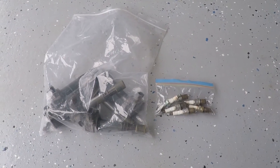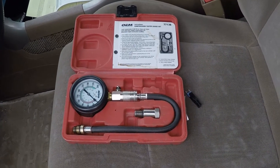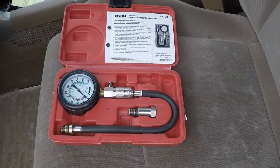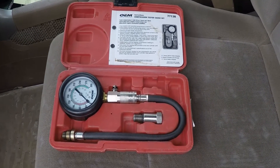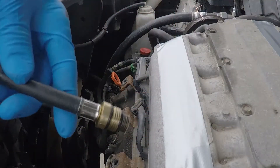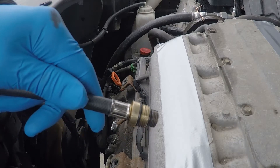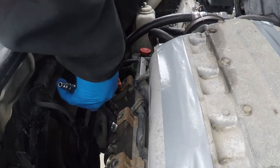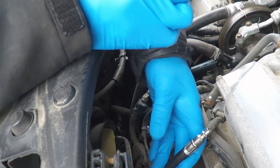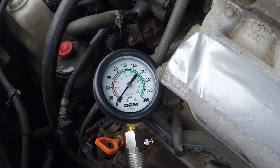Here are the six spark plugs and six coils. Now all I need to do is get the compression tester and test each cylinder. Here's the compression tester gauge set I was able to borrow from a local parts source. I've removed the fuse for the ignition system prior to starting. Unfortunately you're supposed to do this test with the engine at operating temperature — I don't have that luxury due to the timing belt failure, but I'm going to try it as-is. First thing we're going to do is thread the hose of the gauge into the spark plug well and then hook up the gauge. This is done hand tight. Once it's threaded in, you just attach the gauge with the air hose coupling.